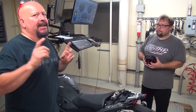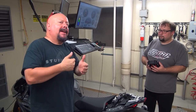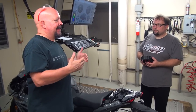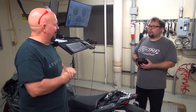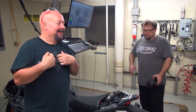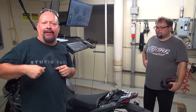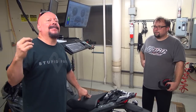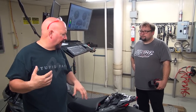Yeah. So let's get to something that I really need to emphasize. Put red flags up, put dots. Just because you have the ability to make changes doesn't necessarily mean that you should use them. For example, 500 RPMs in a modern day engine, I think, is right on the edge of, okay, we're gonna keep stock reliability. What can we change the rev limiter to? You can turn it off. Turn off the rev limiter, okay? We can, right? Yep. But it would end up in instant catastrophic engine failure the minute you weren't quick enough, and believe me, these things are throttled by wire for a reason now. It can happen in a split second, so just because you can doesn't mean you should, and that's where the experience comes in with what Don's done in the past and my tuning experience.